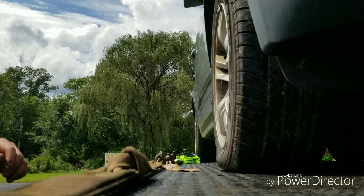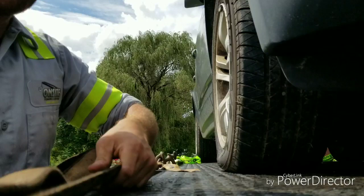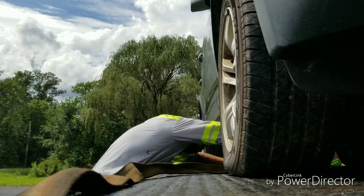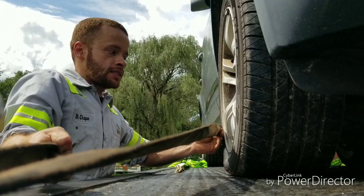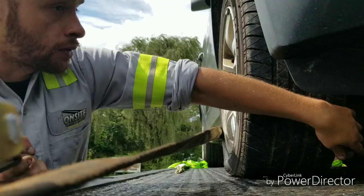This is going to be a quick demonstration. On the mini-Js, to each his own — some people like this setup. I don't mind it either, but I prefer the 8-point tie-down because I find it to be quicker and easier. You're going to feel around underneath the car. Make sure that wherever you're hooking, it's a double-wall slot and not a single wall, because you can tear it — undercarriage damage is a big deal. You can see how I'm running the strap around the tire. That is actually a Wreckmaster's approved way. I like to do it this way because then I don't have to throw the hook underneath the vehicle.